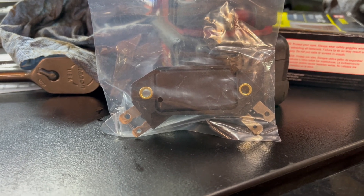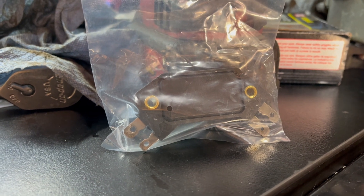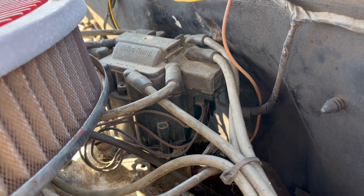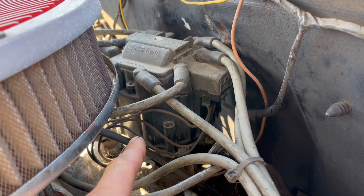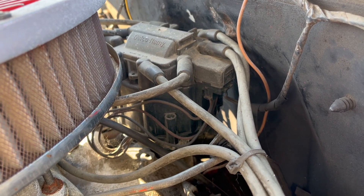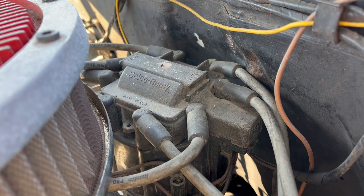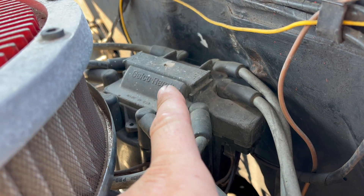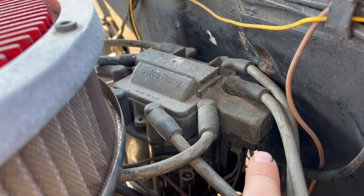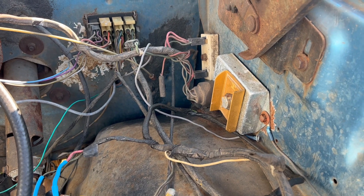And it is my friend. Unfortunately, it was designed and engineered by General Motors. In spite of this, it's quite good. In its original incarnation, that HEI module lives underneath the cap on one of these big all-in-one General Motors HEI distributors. The module is triggered by a pickup inside this distributor, and it fires the coil built into the top of the cap. This entire thing is powered by one wire, which is kind of awesome.